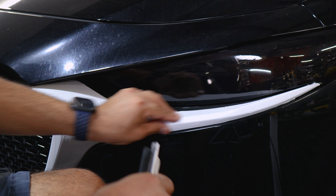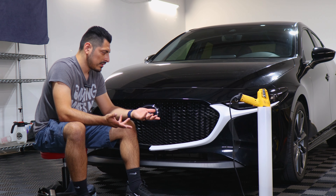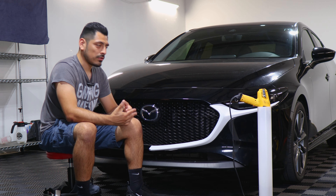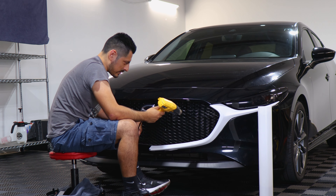The last thing to do is pulse heat the entire panel once you're done. Rinse and repeat the same steps for the other panel, then pulse heat the whole film. To pulse heat, all you need is the heat gun — go all around the film, adding heat around the edges and anywhere you overlapped the film. This way the adhesive on the film starts to cure faster and the film doesn't lift over time.